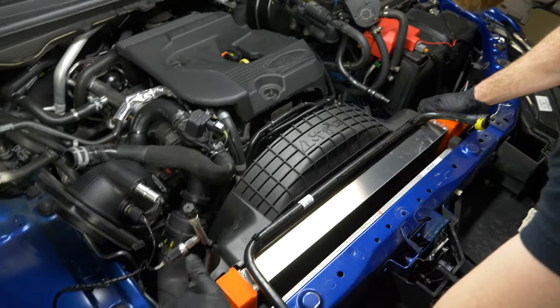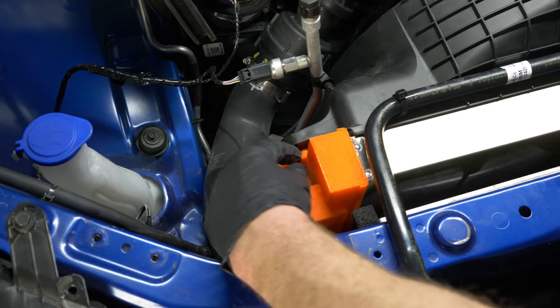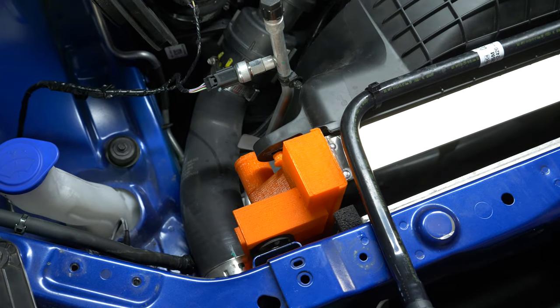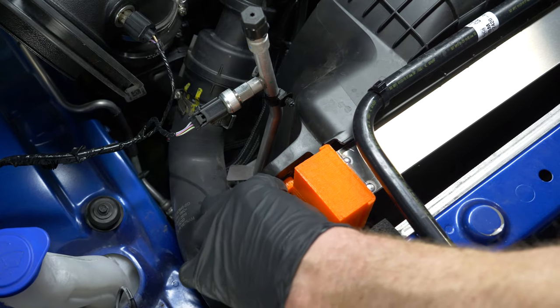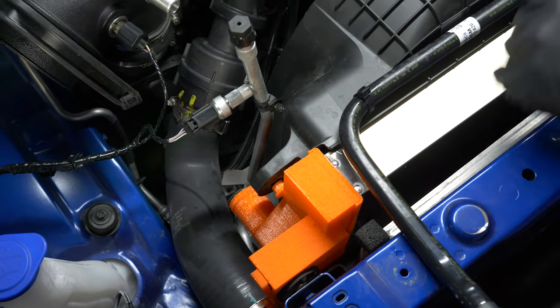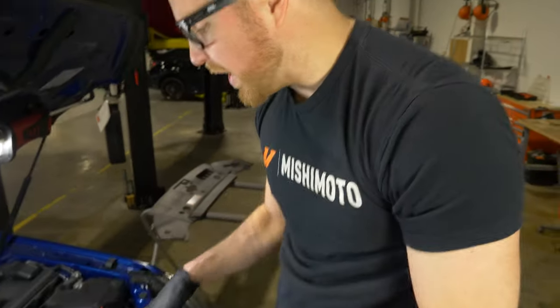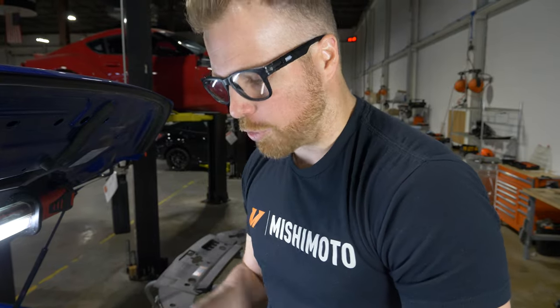Here's one thing that we can see right here on this side, where the fan shroud would mount up to this boss that's on the end tank. Notice how there's a small gap there. If I weren't doing this test fit, I wouldn't know that I'd have to actually extend this out a little bit to make it meet up a little bit better with the fan shroud. So I now know that that's one thing I need to change when I go through and we go to make our very first production core.